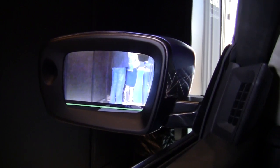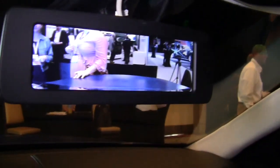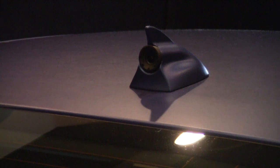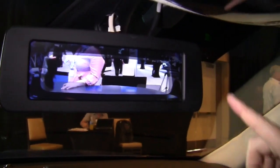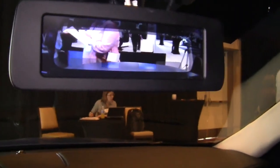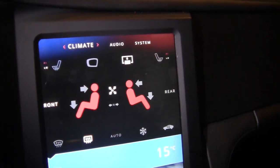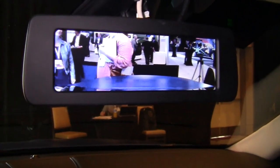There are also 10 ultrasonic sensors in this vehicle to do things like object detection and collision avoidance. The two side view screens are pulling data from two side-mount cameras, and the rear view is pulling from a high-mount camera in the shark fin on top of the car. Here is an approximation of the traditional mirror view — the view is a lot smaller. Simply by leveraging some optics, we can really increase the field of vision to see what's going on behind the vehicle.